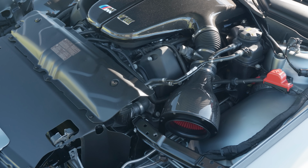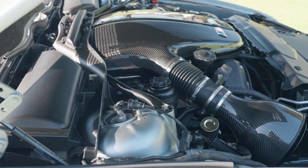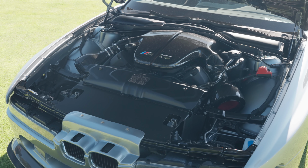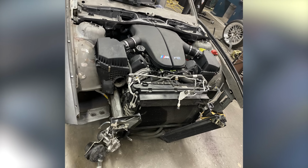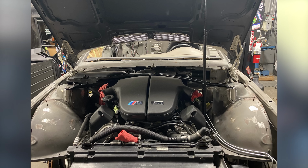So yeah, we contacted Steve Dinan at Carbon, and they built a 5.8 liter V10 for us, 630 horsepower, 490 foot-pounds of torque. We were able to put it in the engine bay. It fits in there just nicely. And we put it in the position where if you need a hose, everything is in the factory position, and if you need a part for the car, it's right off the parts manual. Yeah, so it's totally serviceable.